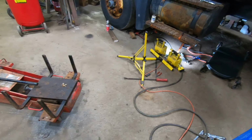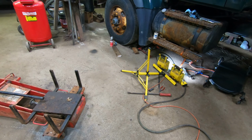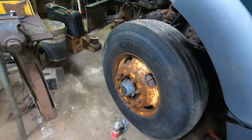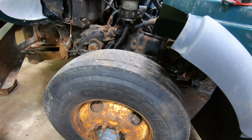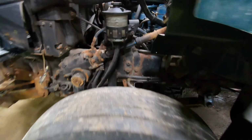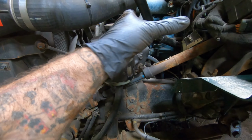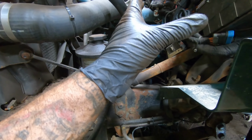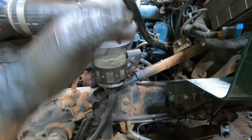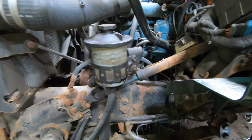I mean, the rear motor mounts, they fit in like a V. So I actually had to turn the engine, because having it with no mounts on that one side for so long, it actually twisted it. It pulled the driver's side back, so it wasn't lined up. I had to push the front foot to the passenger side to get it to rotate a little bit, because when it was sitting in there, it was high on the back side of the mount. With no mounts on this side and the torque, it just kind of tweaked it in there, so I had to pull it back.